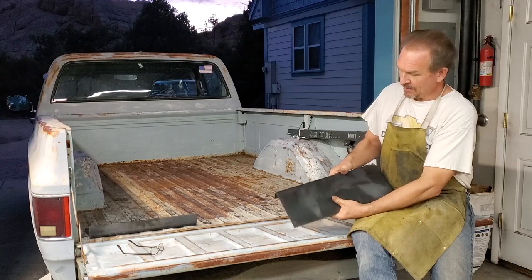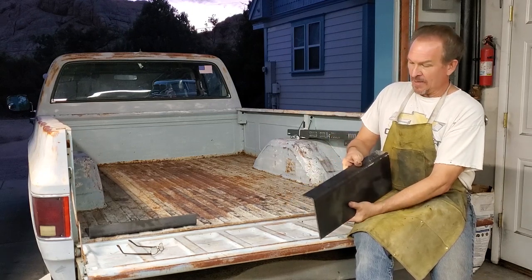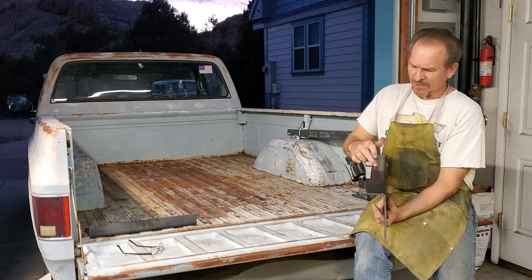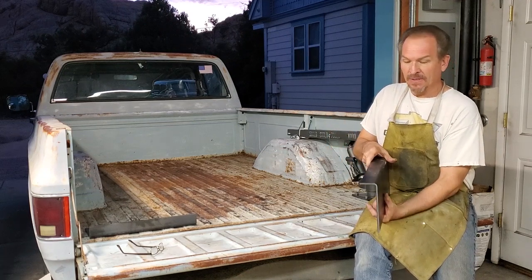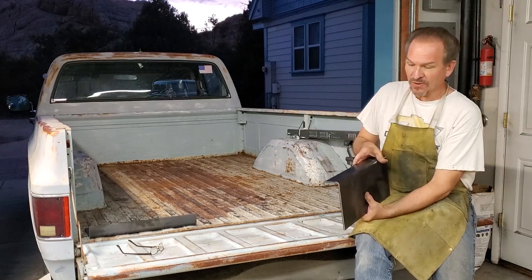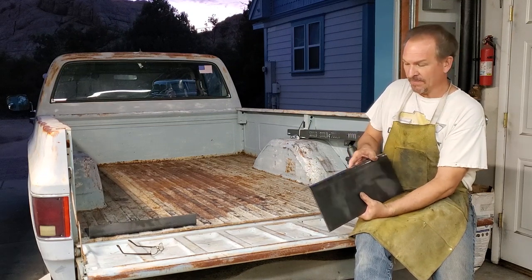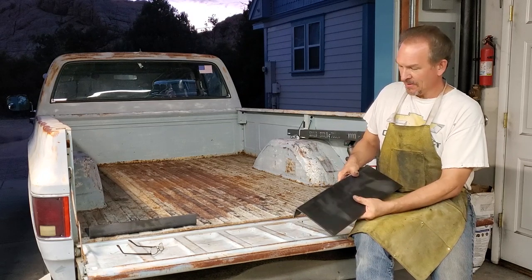So I've had bent up here, on a quarter inch steel, a bracket that's 18 inches long, 7.5 inches high, and 2 inches across the top. What we'll end up doing is drilling a couple holes in it, matching the holes where we mounted the crane, bolting them in place, and then we'll weld them to the frame. And like I said, there's two of them. About $29 at Prescott Steel, I'm sure you have a steel place you can go to in your area. I made this in a couple hours, had it ready. So we're going to put them in.